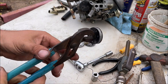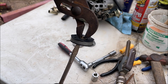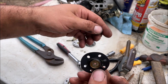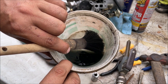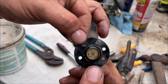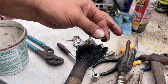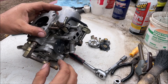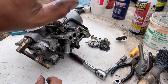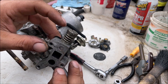You're going to inspect that little washer in there. Everything looks good, but it was stuck 100 percent - that's why we have to go through this. It's got a little nut on there, just hold it and unscrew it, lefty loosey. Whenever you get this apart, inspect that diaphragm. I'm going to go ahead and give this a bath in gas. It's got that little seal - inspect it for trash, give it a bath. It doesn't look perfect but it's not ripped. If it's ripped you'll need a new one.